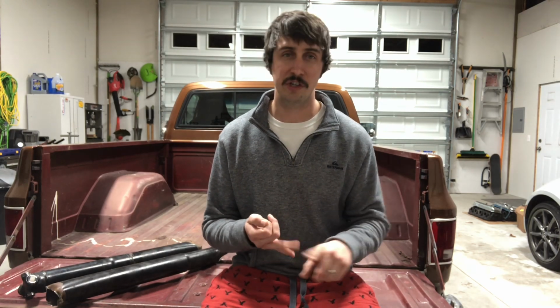I'm looking into steel drive shafts. I'm looking into aluminum drive shafts. I've got 5 inches between both of my mufflers, so I'm a little bit constrained there. I can't go to, say, a 5-inch drive shaft or even a 4-inch drive shaft. I don't think that would leave me enough room. So I'm gonna look at 3 and 3.5-inch drive shafts. I've been in contact with the local drive shaft shop, Strange Engineering, Shaft Masters, DSS, so all the big names in drive shafts. I'm looking at them.